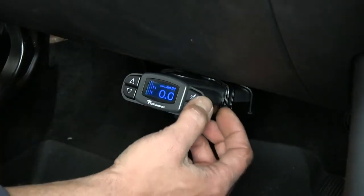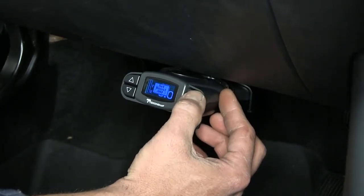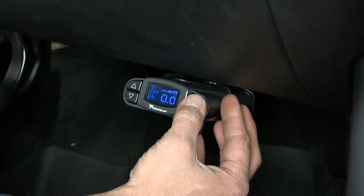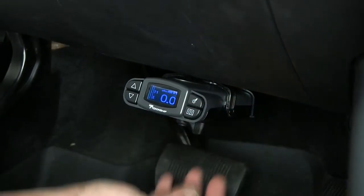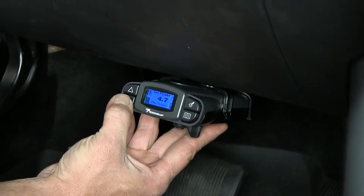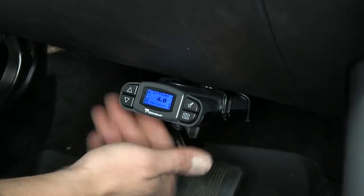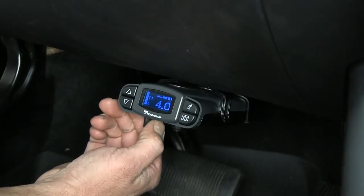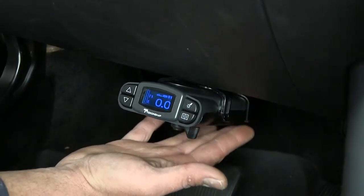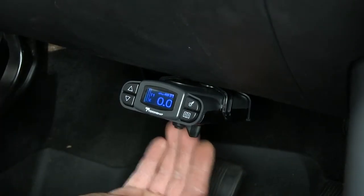Here in the top corner we've got our boost level — boost level two, three, we can turn the boost level off, or boost level one. The boost is going to allow us to set our initial braking power and how aggressively those brakes are applied. In addition to that, over here we can change our power, our maximum output. So if we set it at four and go to max power to our brakes, as you can see it's going to go right up to four and that's it. This is going to send power to our trailer in proportion or in relation to how quickly our car is decelerating.